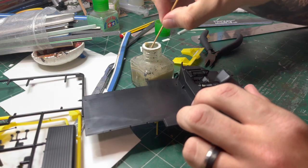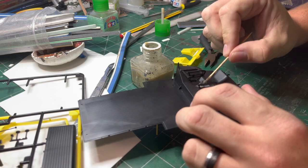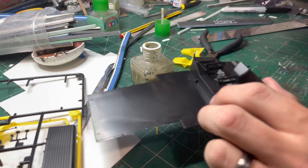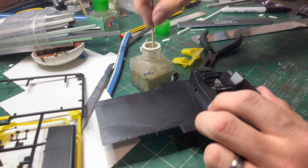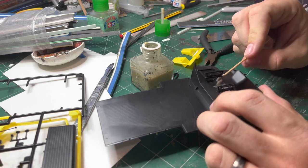What I'm doing there is filling the hole in the middle of the chassis for the gear stick. What I'll do is drill it over to the right slightly, because it's quite central for the left-hand drive version, whereas if you look at pictures of the right-hand drive H van, the gear stick is further towards the driver's seat — although I think they did use a lot of left-hand drives in the UK for the H van.